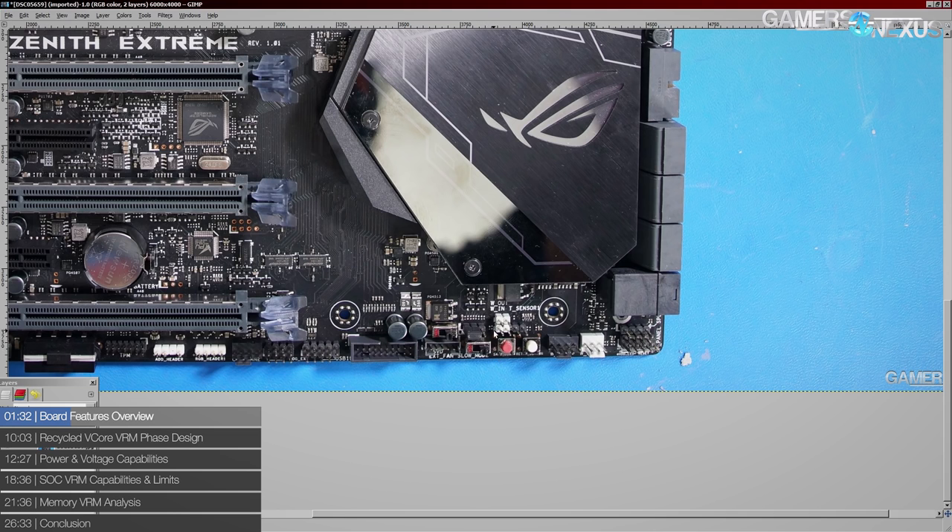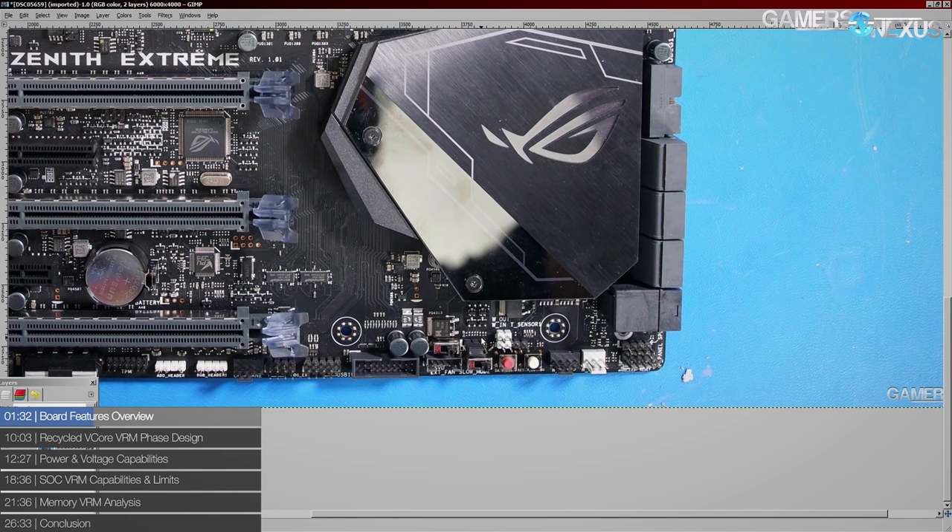The RSVD switch is generally used by ROG motherboards to apply a voltage profile to remove cold boot bugs and cold bug issues. On Intel motherboards from ASUS this switch is amazing — for a lot of CPUs you just flick the switch and everything works, skipping a huge part of the fine-tuning process. But on Ryzen running sub-zero is a lot more complicated, so I have suspicions that this might not be quite so straightforward, because even if the switch sets everything up correctly it might still not work — Ryzen on LN2 has all kinds of issues even at the best of times.